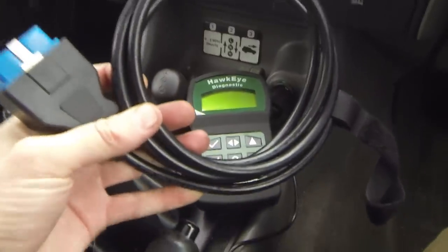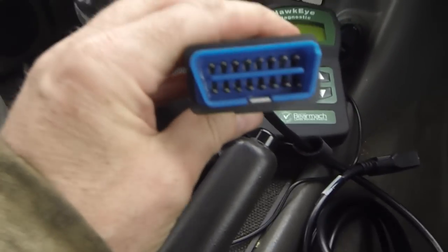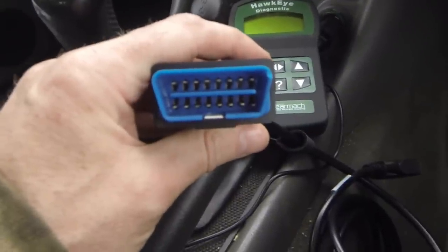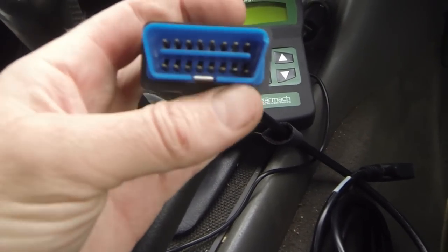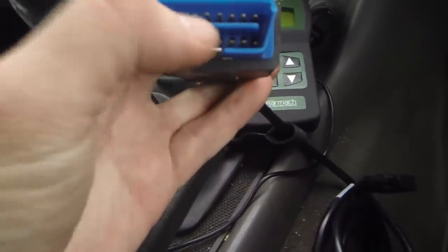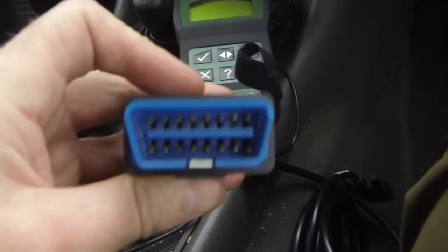This is the actual connector you need to connect the tool to the car — the J1962 connector. It's basically a female 16-pin D-shaped connector with two rows of eight pins. There are two types: Type A is for 12-volt vehicles and Type B is for 24-volt vehicles. They've made a slight change to distinguish them — the Type A has one continuous strip of plastic through the middle, whereas the 24-volt one has a break in the middle. That's to stop you plugging the wrong tool into the wrong vehicle. So this is the 12-volt Type A.